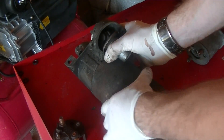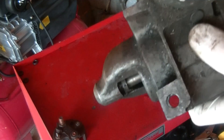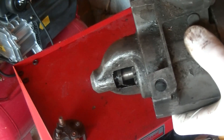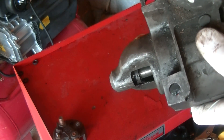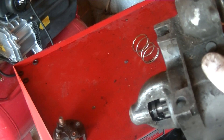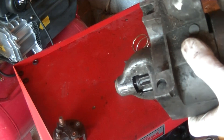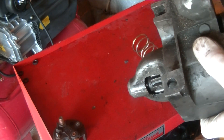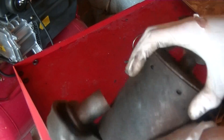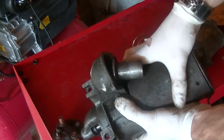When this gets pulled back, that is the gear — you can see how it spins a little bit too. That's so it can engage the flywheel. These teeth right here engage the flywheel. This whole bottom part is grounded to the battery, and then you have the positive cable that supplies power to this.